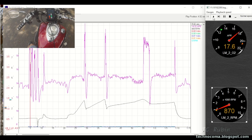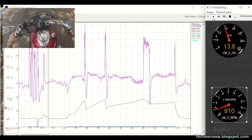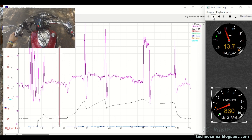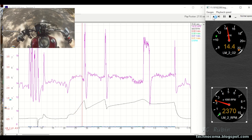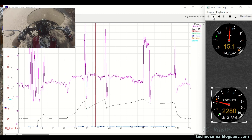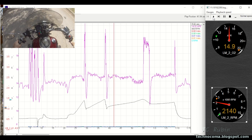Starting the recording and syncing everything up, I have an immediate observation: the mixture is a lot richer on this cylinder. It's between high 12s and low 13s just sitting at idle. But as I come off the throttle, it's leaner than the other one. That means if I go back and lean this out - which I will in the next run - I know the PMS screw is going to have an influence and make this off-idle even leaner. Right now it's at like 14.8 to 14.9, seeing 15 up there.